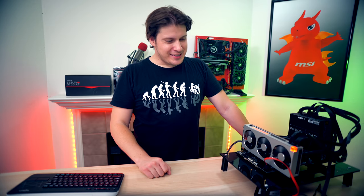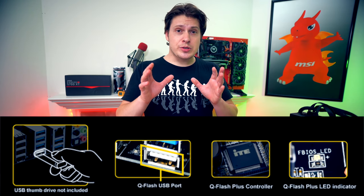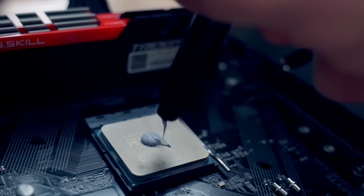As expected, we need to flash the BIOS with Ryzen 3000 microcode. How do you do a BIOS update without a working CPU? You use Q-Flash Plus — unfortunately, this board doesn't have it. That's a USB port marked in a different color that supports a USB thumb drive readout to push new code to the BIOS. We do have a Ryzen 2600 to push the update. Let's install it and see if it works.